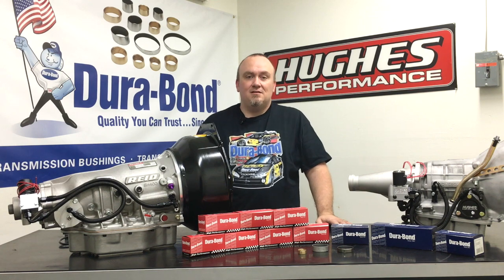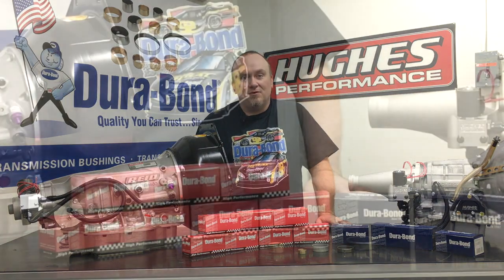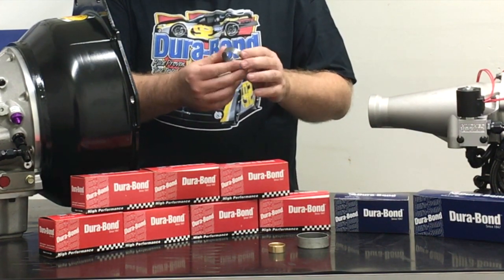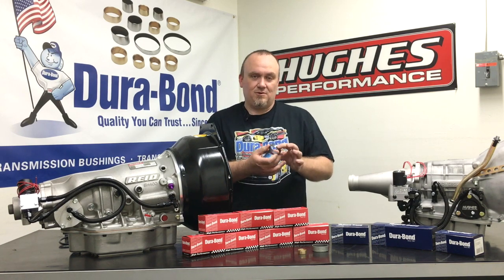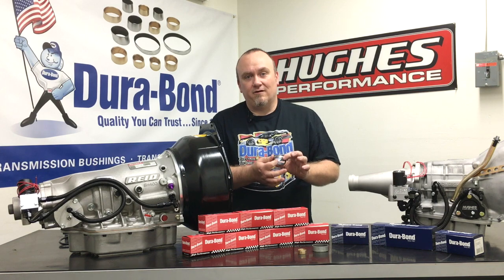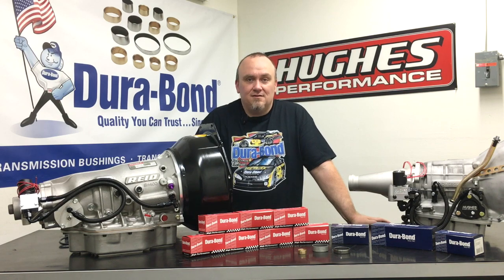We prefer to default to the PTFE coated bushings in our product line wherever they're available, as well as the dry film coated bushings. The coatings add an additional amount of lubricity between the bushing and the shaft or the hub. It also offers greater embeddability, reduced friction, and lower temperature operating on the bushing surface. The coating is wearable, so as you put miles on the transmission or drag racing usage you are going to see the dry film or PTFE have a little bit of wear if you ever disassemble it, and that coating will eventually wear off.